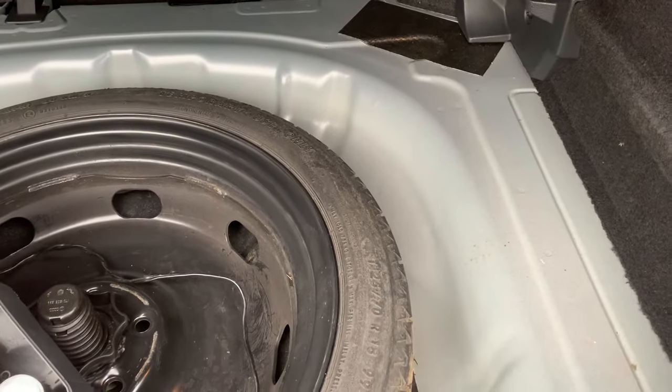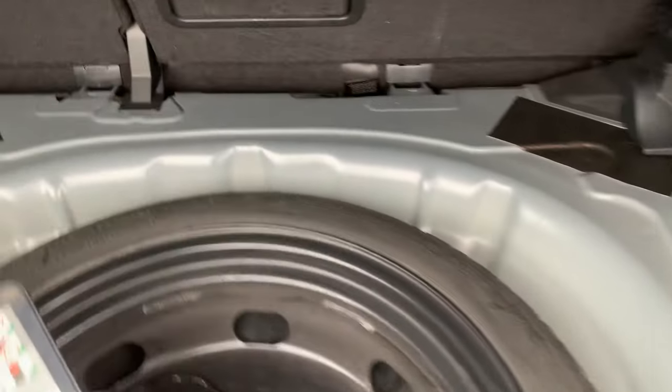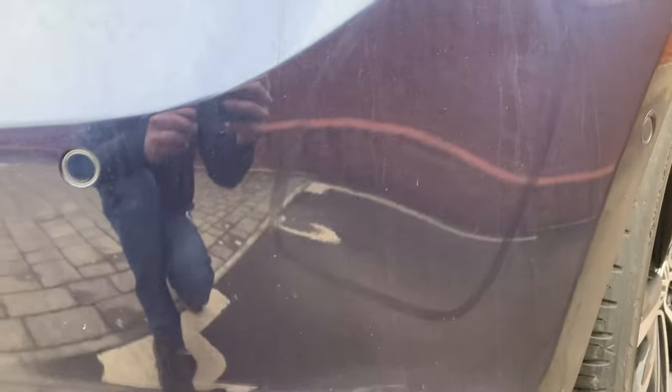When braking, the water flies forwards out of this well and goes down there. You've got an air vent right here behind here — the seal will go on them — and basically water gets through, filling the cavity behind that.